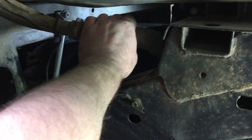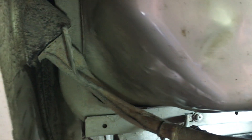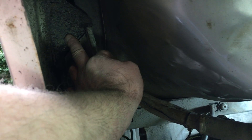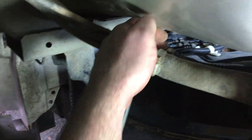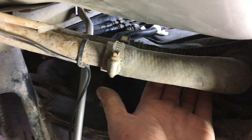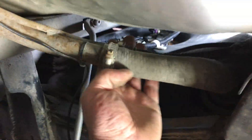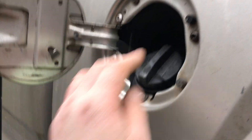This is somewhat in the way but I can still get my hand in there. That's a flexible hose that goes to the fuel tank when you put gasoline into the filler neck. This is a recirculation line that takes the vapors from the top of the tank where the fuel cap is and allows them to be recycled back into the EVAP line. It feeds into a connection right here — you have to push the white clips on either side to get that hose to come off.